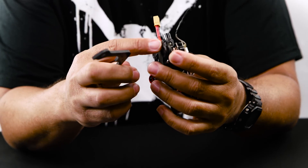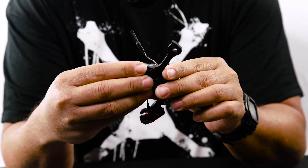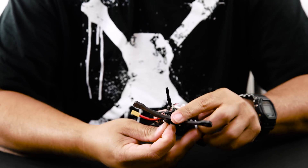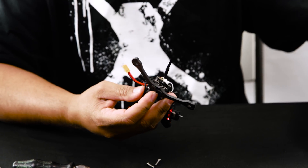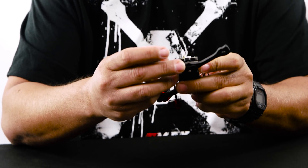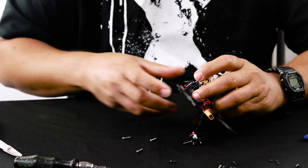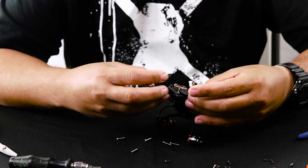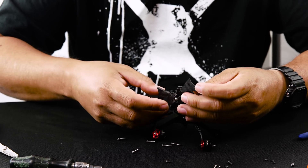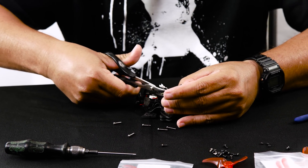You'll see the bottom plate and the mid plate, and the arm basically just slides in between those two — you're just going to line up the holes. I'll start with the one that has the lock nut since we need to get the needle nose through there. Got the first one through, holes lined up nicely, and I'll go ahead and snug it up. Some of you may have the 2-inch with 2-in-1 arms already, or if you've replaced your arms with the 2-in-1. This one has the four individual arms, just in case you see something a little different on this install.